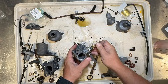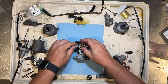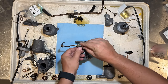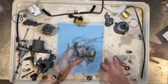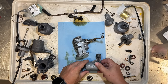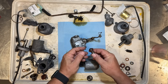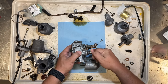Make sure the jet can move — it does. Now we can put in our pin and the new cotter pins. Check the movement — looks good. Now we can install the fuel bowl. There's a seal that goes on the top and bottom of it. I'm going to hold it on with the original stud; there is a replacement bolt you can get which means fewer parts. I'll have to reuse this fiber washer — for some reason it doesn't come in the new kits. We'll get this on the carburetor and tighten it down with a five-sixteenths Whitworth.